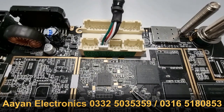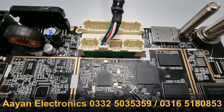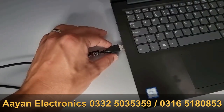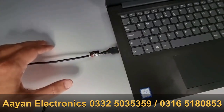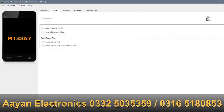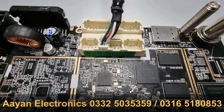After that, use your tweezers and place them on the two test points on the motherboard — no need to push hard, just so they make contact. While holding the tweezers down with your other hand, insert the USB cable into your computer, then keep holding the test points until the format flash is done, which should be within a second.